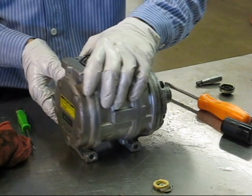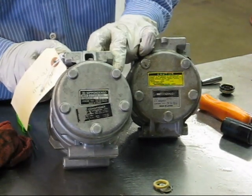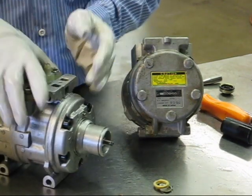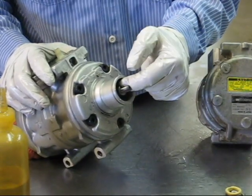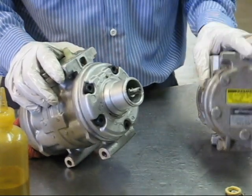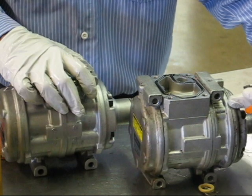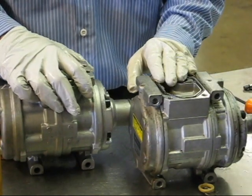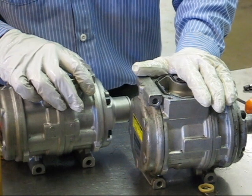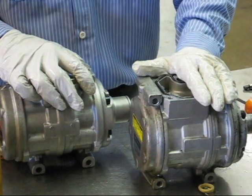This is a 10PA series compressor — they usually say 10PA on the back. The other common Nippondenso of the 80s was a 10P series, designated without the A, and that is also marked on the rear. Some of these earlier ones you can change the shaft seal from the front — if you can, you will see a snap ring. If that snap ring is not in there, you do have to reseal it using basically the same method as this. Pretty much any GM compressor that uses through bolts — V5s, H-series — reseals the same way, with the exception that GM compressors may require some special tools to remove the clutch. This is Bob with Sentry Auto Air Conditioning. Take a look at our catalog page at SentryAutoAir.com to purchase the seals and seal protectors to complete this job. Thank you.